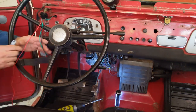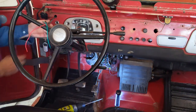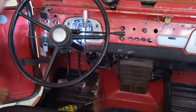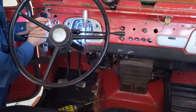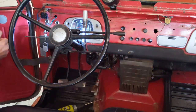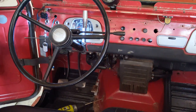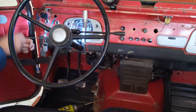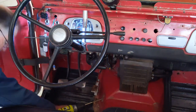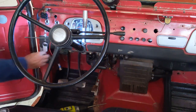I'll clip them off to length and add a couple of zip ties. Now we're going to strip and connect the wires for the switch to the wires I just installed that go behind there. I'm stripping everything, twisting the new wires on, and soldering them.